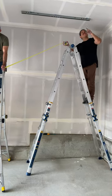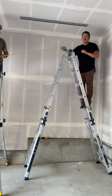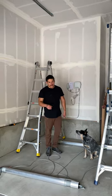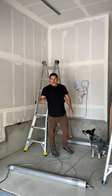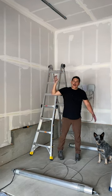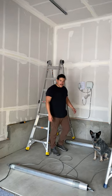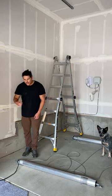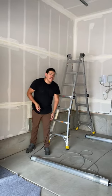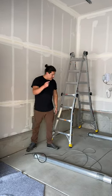With both nuts with springs placed in the struts, measure to make sure they're 51 and three-quarter inches apart. Now for the red and green tags: imagine your control box facing the wall. With your back to the wall, the red motor goes on your right side and the green on your left. When you install them, you want the cable side toward the wall with the cable facing up and the L-bracket facing up as well. We'll carry them up together with the screws ready.